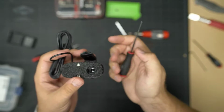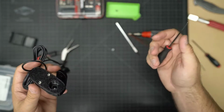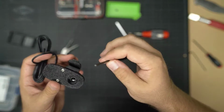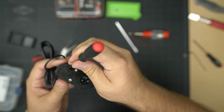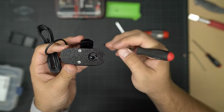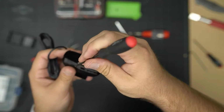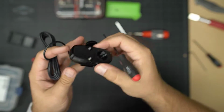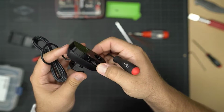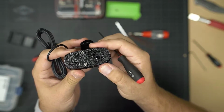That's all I wanted to do in this video was show the assembly of this, which was literally pop off a faceplate, take 3 screws off of the webcam, pop that faceplate off, make sure to save those 3 screws, and attach it in order. And voila, we now have a manually focusable C270 camera from Logitech.